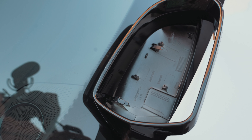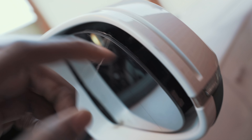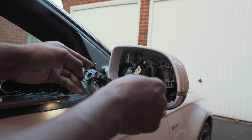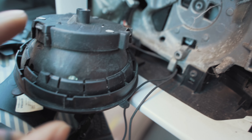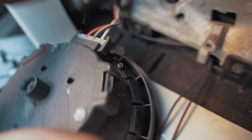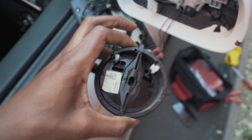The first thing I need to do is take the glass off. I've got to be careful because it's a heated glass - if this is damaged it'll cost however much to replace, so I can't put too much pressure on it. Then we remove the motor - there's a long screw right in the center of it. It's got two latches at the top, so be careful pushing those out. Then we've got to remove this connector, take that off, and then access all the other screws.